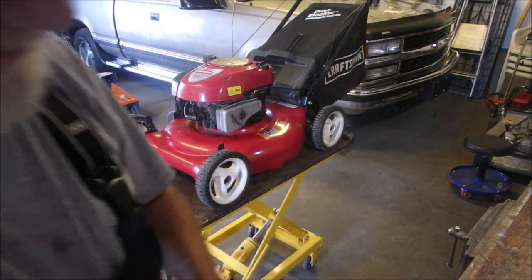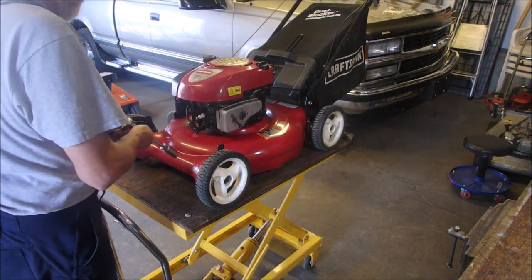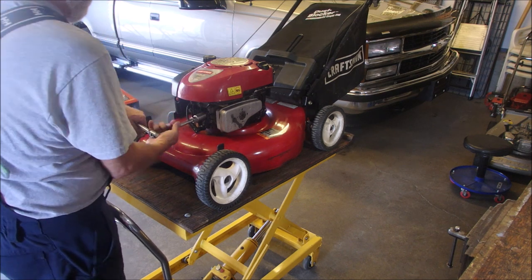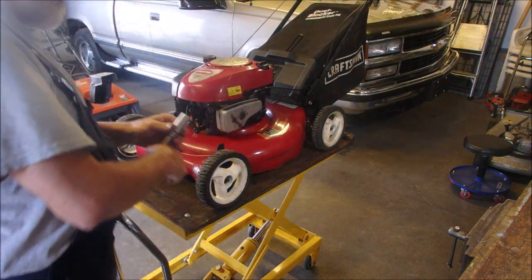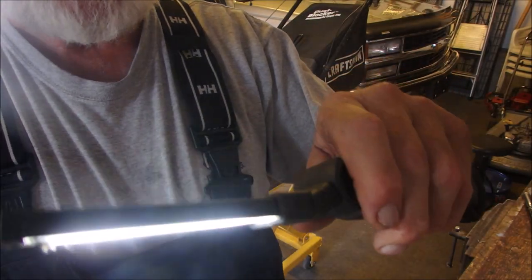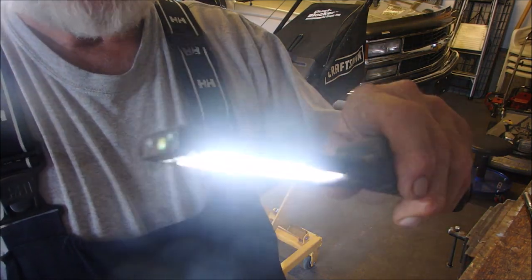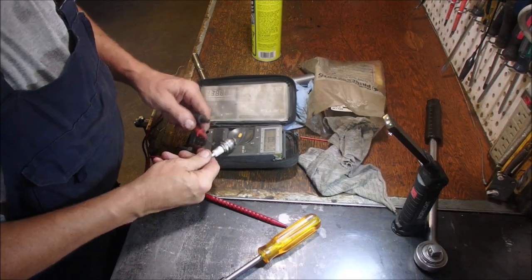Sorry about that. I was just re-aiming you. It's an RJ19HX. Well, we're gonna get rid of that. It has to be carboned up the way it was running. Not as bad as you'd think. I'm going to clean it and measure it. Right back. All right, I cleaned up this HX plug.